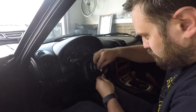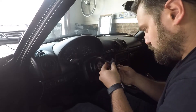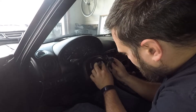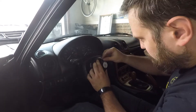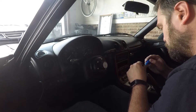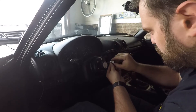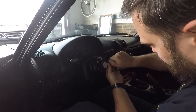Next I simply plug in the wires to continue the horn connection to the quick release snout. I then bolt this onto the hub adapter using some hardware purchased from the hardware store - it's the same thread pitch as the steering wheel bolts and should go in easy. I also use thread locker on these.